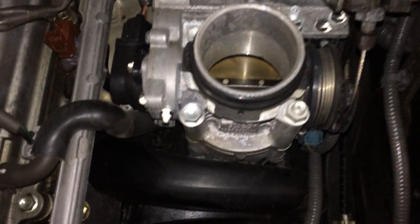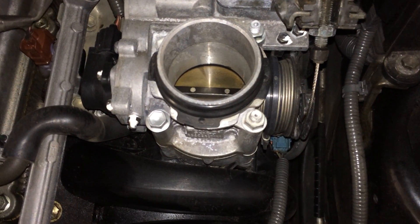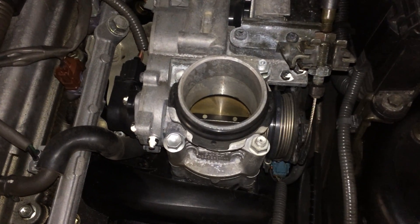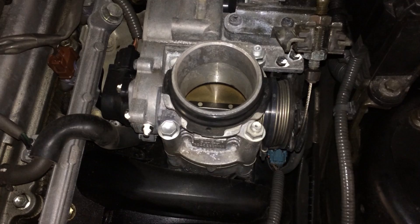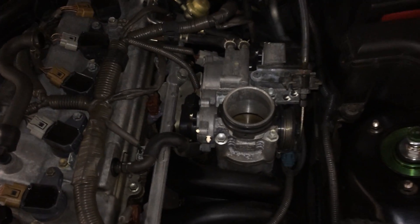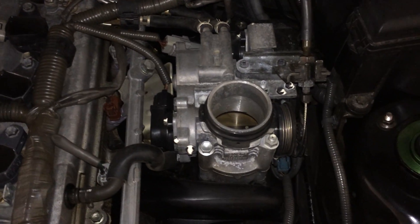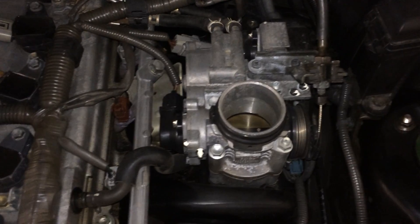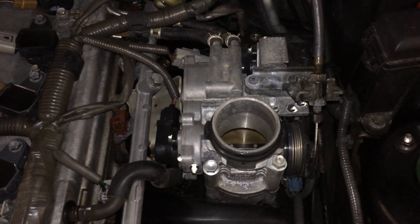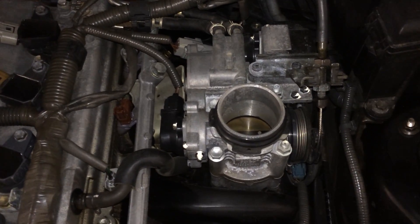This one's an automatic. I don't think it gives you full throttle in first gear at all. In second gear it manages to get full throttle at about 4,200 to 4,300 RPM, which is doing about 70 kilometres an hour. When you're above 80 k's an hour it's not really that bad — it's got enough overtaking power and it wants to rev. But in those lower gears, when you want to take off from a roundabout, lights, or a corner, you tell it to do something and it really doesn't want to do it.